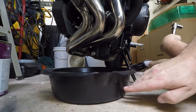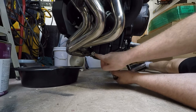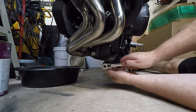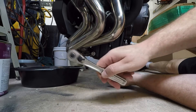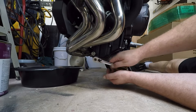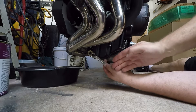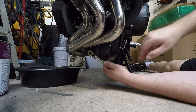Now you're not going to leak oil whenever you're taking out the oil pan bolt. This is a 17mm, so make sure you use that. You can either use a wrench or a socket — I'm going to use a socket today. I would not use an extension right there just because you might hit the pipes. They're also hotter than hell so you don't want to mess with those. When you're going up make sure you go straight up this way. Don't have your arm near the pipe in case it slips off — you don't want to burn yourself.